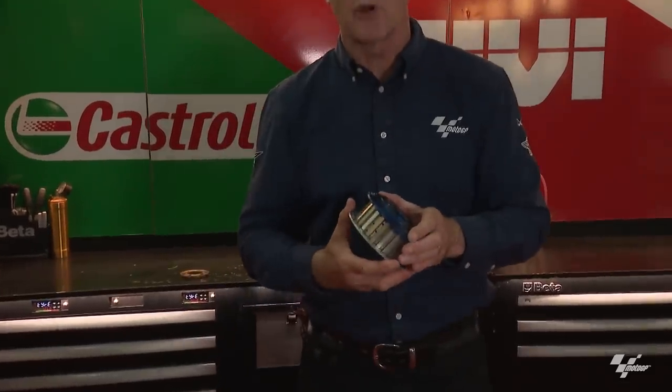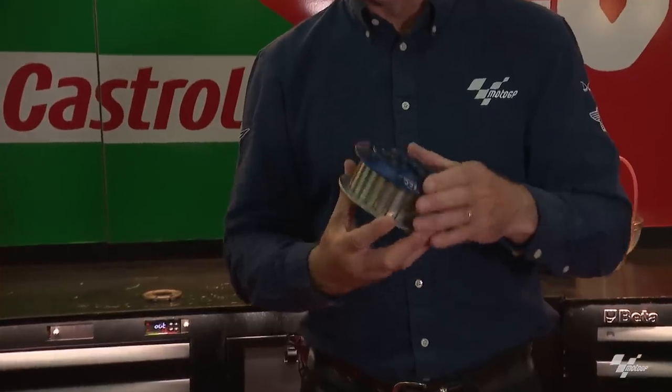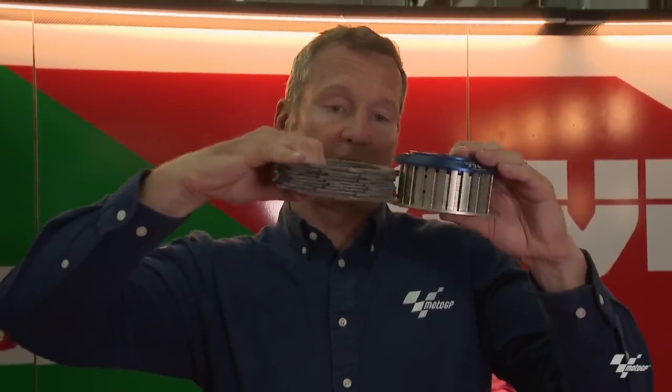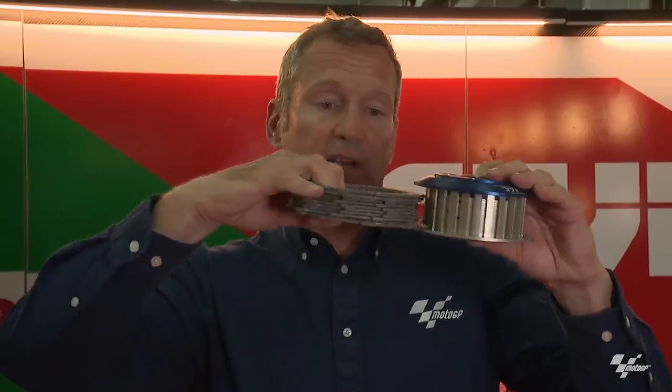The same entering corners — I'll come to that in a moment. With the advent of slipper clutches, things made a good step forward. You didn't have that chattering and bounce. To explain what a slipper clutch is, I've got one — not from Alex Marquez's Honda, but from Moto2 that we're allowed to look at. The clutch plates — the steels and the fibers — fit in there alternating, steels and fibers. Those are the clutch plates.